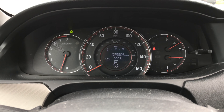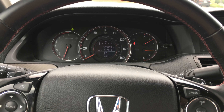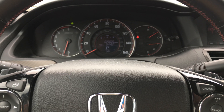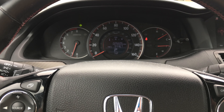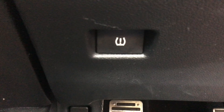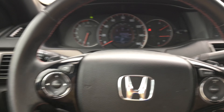Now, if you still have tire pressure issues, the light will come back on. Obviously at that time, get your tire checked. In this case, everything has been repaired and checked, so just to turn it off, you press and hold that button right down here for about two seconds and the light will go off. Hope this video has been helpful. Thanks for watching.